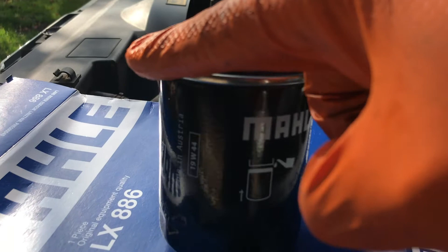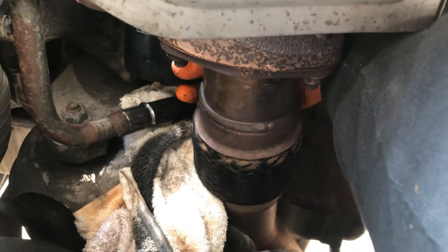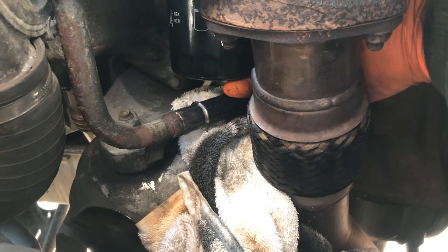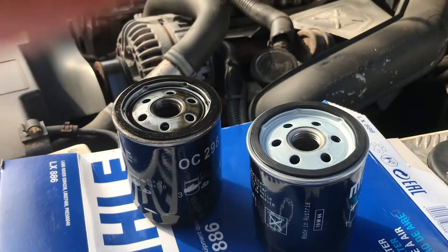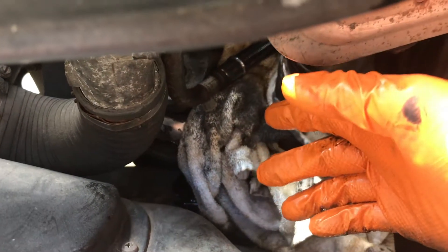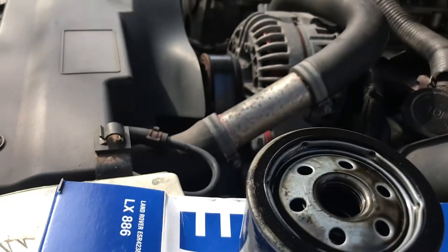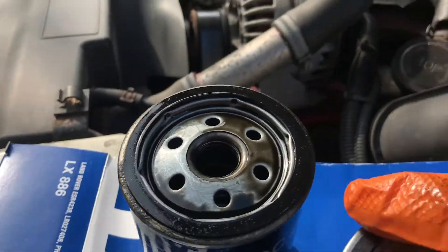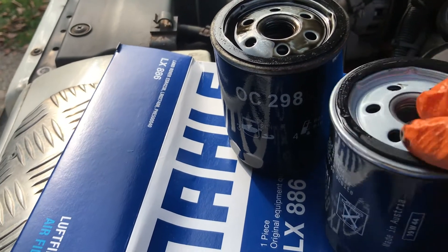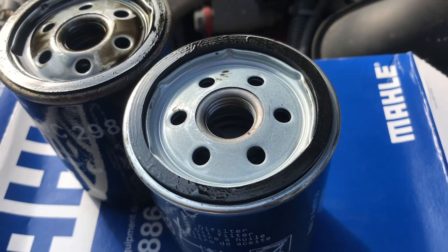You just want to run a bit of oil around the rim when you take it off, just to help it seal. I'll get around the back and try and tweak it off — it's actually undoing already. There we go. It was a bit oily, funnily enough, and got a bit mucky. But the cloth I put down caught most of it. When you bend it forward to wiggle it out, oil comes out, but the old rag picked up most of it. I'm just going to take a little dollop of oil and work it around the rim of the new filter with my fingers, just to help it seal. Then I'll screw it back down and tweak it up hand tight. Job done.